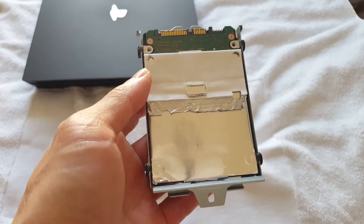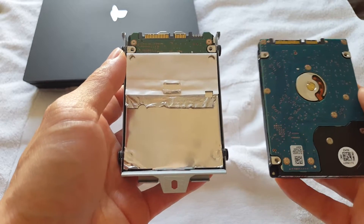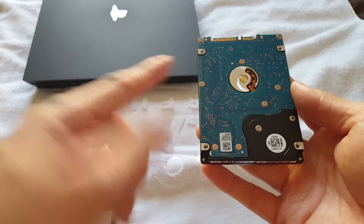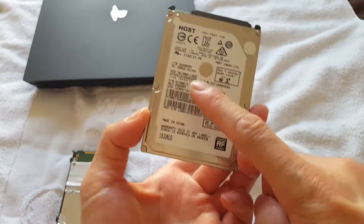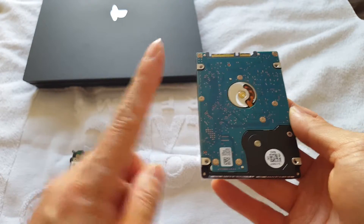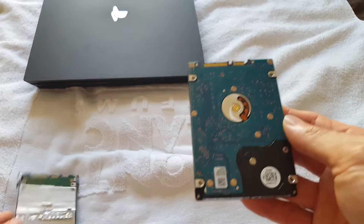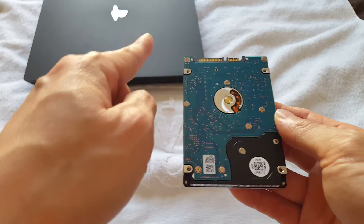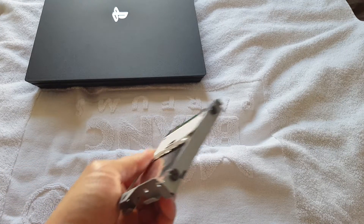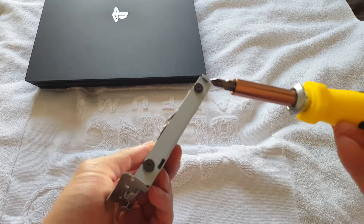The thing you want to remember when you put the drive into the hard drive slot is to make sure the bottom side faces up. This is the label side, and this is the underside — make sure the underside faces up. When you put it into the slot, it goes like this, with the pin facing inward into the PS4 Pro.